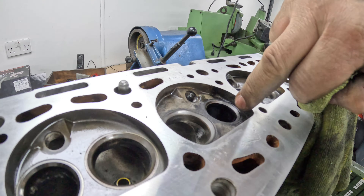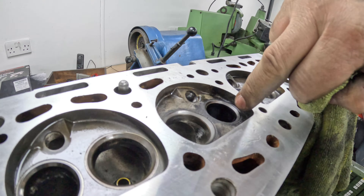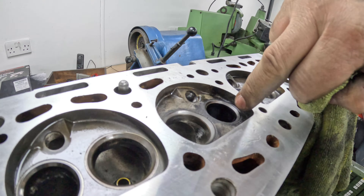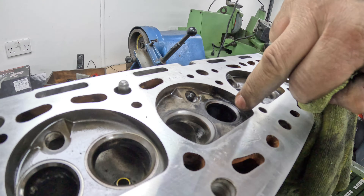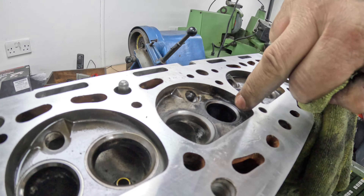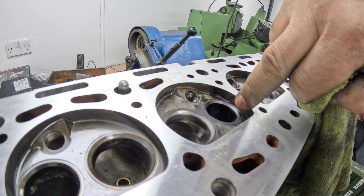See it self-centring — I press this button and you'll see the Centronic moving. As soon as this light lights up, that means the head of the machine is centralised into the guide and I can lock that part off. It's ready to cut now. Put the Vero Drive on it. That seat there wasn't actually as bad, but it was a little bit out on the back corner. That one probably would have ground in.